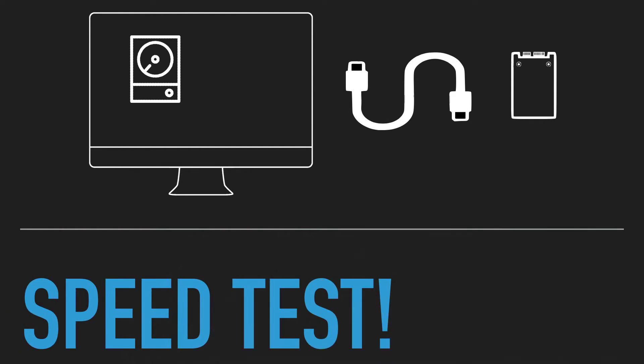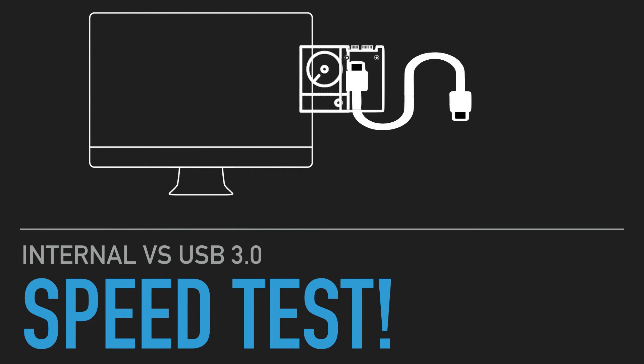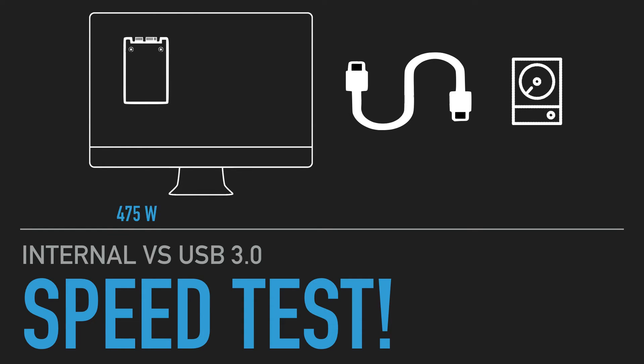It's speed test time — internal speed versus the hard drive over USB 3.0. Right off the bat, I tested the SSD while it was still outside before the swap: the internal hard drive was 190 write and 192 read, but even over a USB 3 cable the SSD had almost twice the performance at 330 write and 430 read. After the swap, the difference was even more insane — the SSD shot up to 475 write and 510 read, while the hard drive dropped down to 102 write and 114 read.